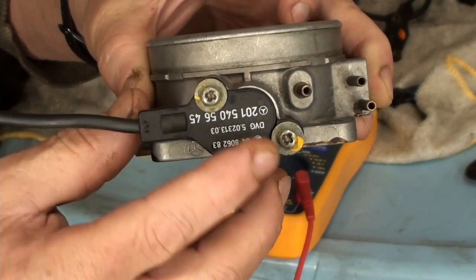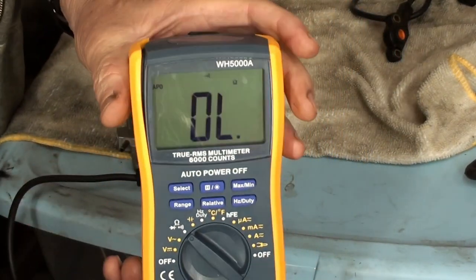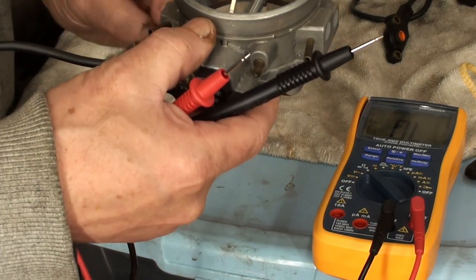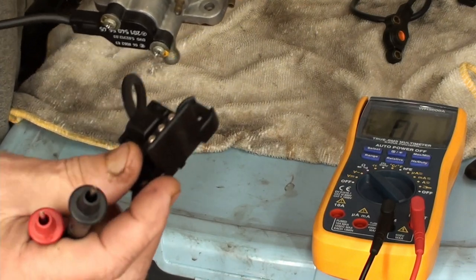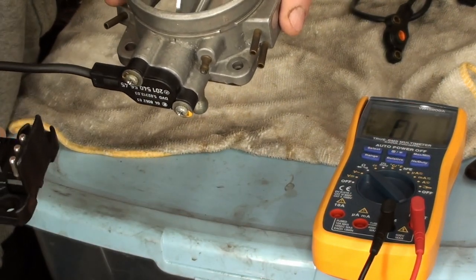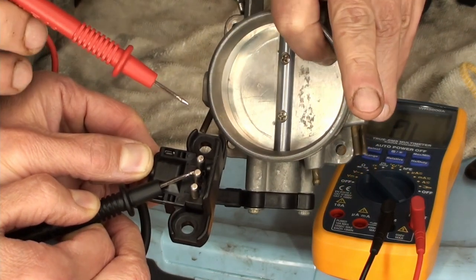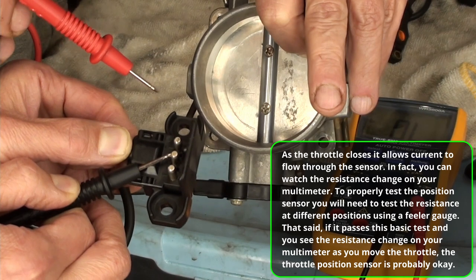We certainly don't want to put the whole car together and find out this doesn't work. We'll take our multimeter, set it to ohms, and I have it audible. Then I'm going to have my beautiful assistant come over here. I'm going to hold this at full open throttle, and she's going to take the common and put it on number two, which is the center. So I'll hit number one, and we hear nothing. But let's close it to closed — and it's on. Hear that?